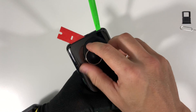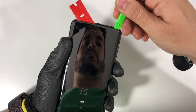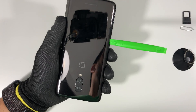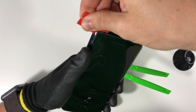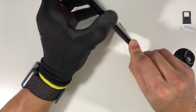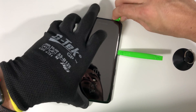It's also useful to use the help of other prying tools — stick one to go down the other side of the back glass. Once you have the prying tool in there, go ahead and remove the suction cup. I'm going to give it a little bit more heat to soften up the adhesive a little bit more. Now just go down one of the sides with the prying tool — gently go down the entire side, don't do it too fast so you don't break it. I'm going to use the help of another prying tool as well and go down this side of the phone. Continue down both sides, take your time and don't rush it so you don't damage the glass.